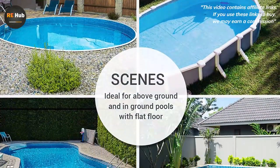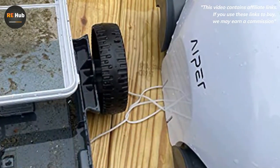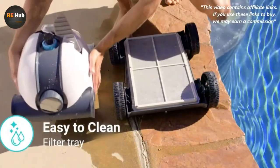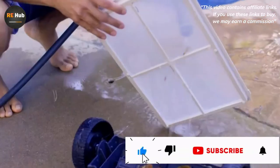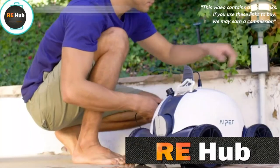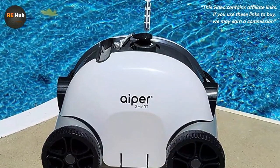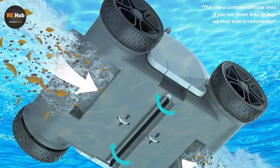To get it out of the pool, use your phone to remotely drive it up the wall of your choice. The up arrow on the control moves it forward; a single press on up or down starts it moving in those directions, while left or right arrows have to be pressed and held. When the robot breaches the waterline, grab the handle, hit pause on your phone to stop the drive, then start to lift the robot out of the water while tilting it forward to empty it of water — otherwise it's pretty heavy and the water will dump after you set it poolside.